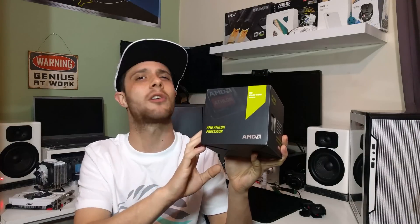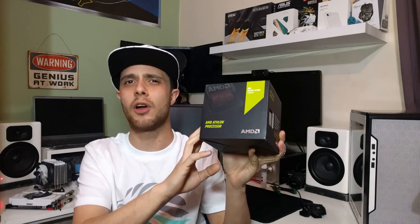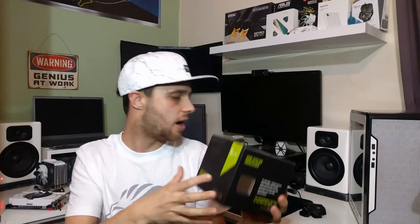So you don't have to go out and buy a new cooler straight away - you probably will want to because of the looks, but you don't have to. I'm going to try and do some overclocking with this as well because it's a 95W TDP chip, and if it's rated to 125W, let's see if we can hit maybe 4.4 or 4.5GHz.